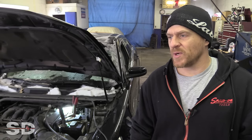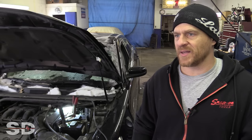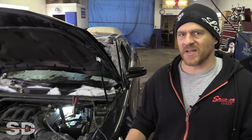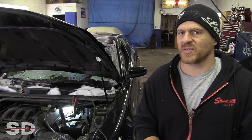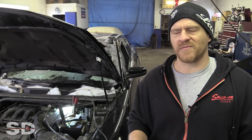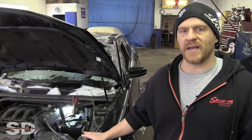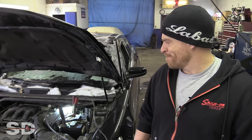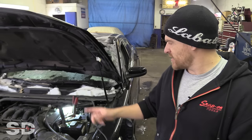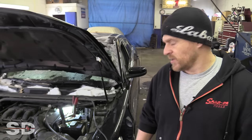Something else I forgot to share: there was an issue after the starter replacement. When the starter was replaced and they connected the battery terminal, either the car cranked on its own or they started it with the key and then couldn't shut the car off. That made me start thinking about the ignition switch. That's as far as I've gotten. The car came in with the battery almost dead, and the customer still continues to have this intermittent no crank situation.